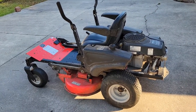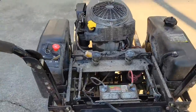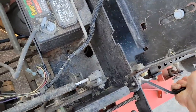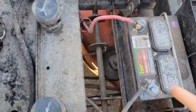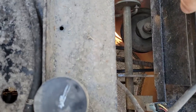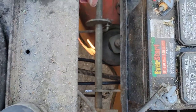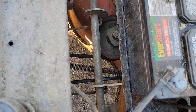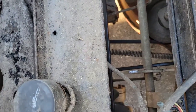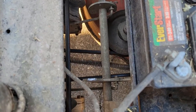I'm going to pull the seat up to show you where the mechanism is. The brake is engaged right now — when I disengage it, you're going to see this axle rod here turning. Right in the center area you've got two rods, and when I engage the brake it's pulling tension on those rods. Those rods go all the way back to the axles where the wheels are connected — actually on the transmission — and that's where you get the brake effect.